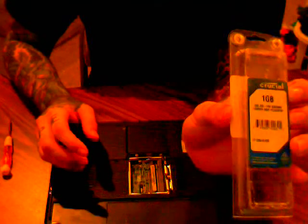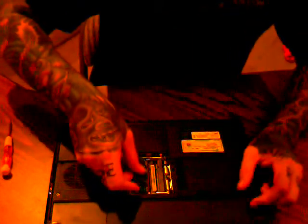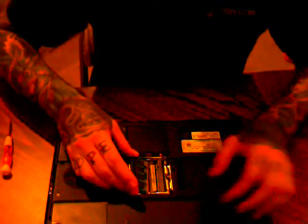This is the new Crucial 1 GB memory module that we'll be installing. Let's take it, line it up with the pin configuration. You want to install it at a 45 degree angle. Lock it into place, turn the machine on to make sure it boots up,